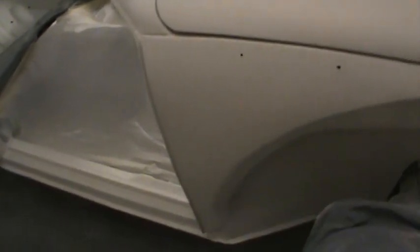I'll keep messing with those. This here — I don't know what this is, rain gutter seam — this is what comes apart like a door skin seam. This clip basically goes on, gets welded, and gets folded back over like a door skin. You can imagine when you've got to pry the factory seam open and try to put it back together and make it look like something — it's not very easy, so that would have to be revisited if I ever did that again.